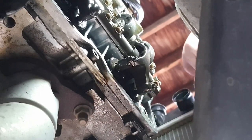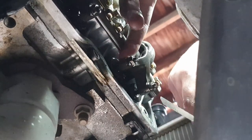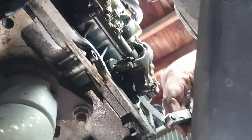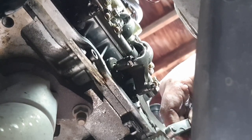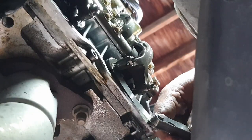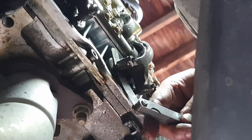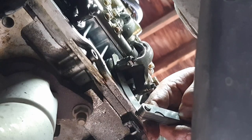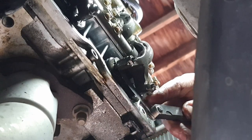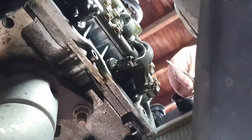What I can do is check a second time with the feeler gauge, and I've been doing this on all 16 valves, like I said, so far, or 12 up to this point. And there's still just a tiny bit of resistance there, similar sort of bunching up as it goes in, maybe a little looser than it was previously, but this spec is not super, super critical. And like I said, in this case, I'm setting the lash on the tighter end of the range.